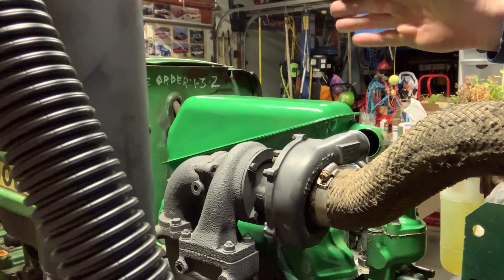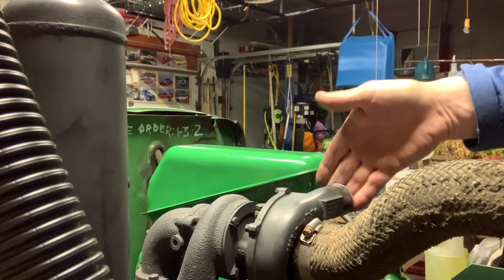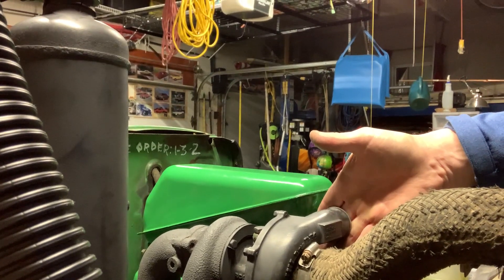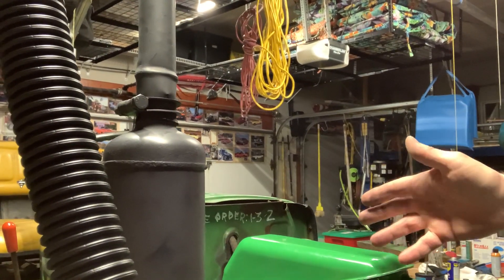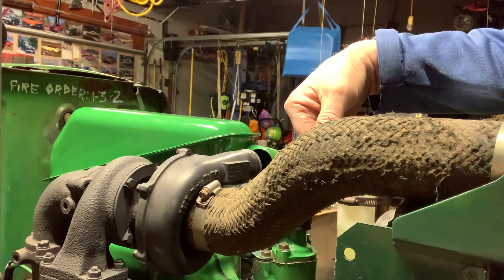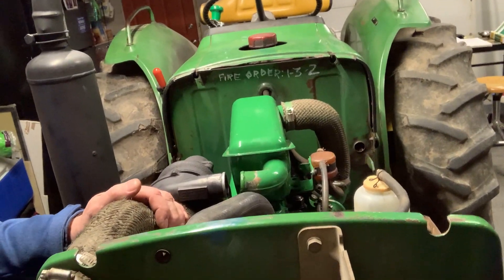That's one of the problems that can occur — not very often, but watch YouTube videos on runaway diesels and you'll see what I'm talking about. So I have this open so that if it did run away on me I could stick a plate of steel against this to stop the airflow and starve the engine of air and it would die. I don't like using wood because it's porous and can warp. Another thing I could do is put it in fifth gear and let the clutch out — the engine would die, though it's hard on the clutch.